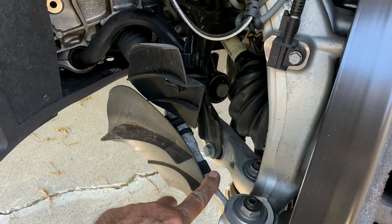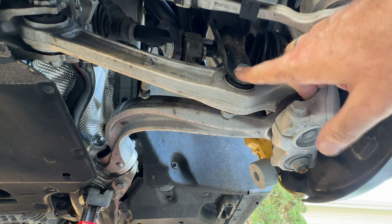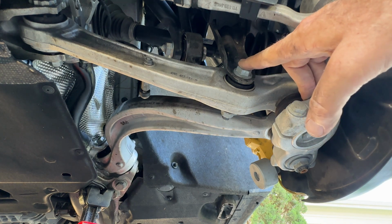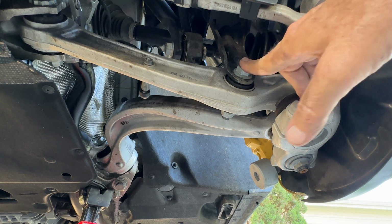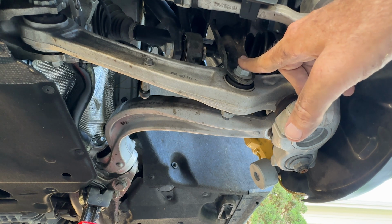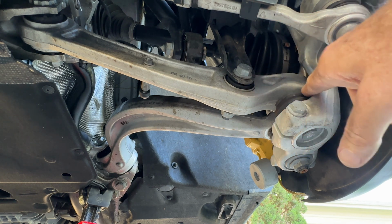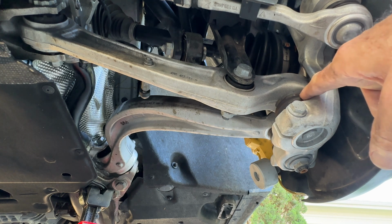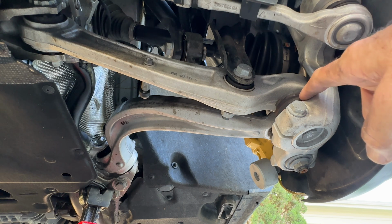This air turner here makes it a little bit difficult to see things, but I think from this angle we can see this point, which is where the air spring, shock, and stabilizer bar, since they all come together a little further up, they all bolt right here to this link. And so we can look at the length of this link and where this position is relative to the overall length to determine the motion ratio.